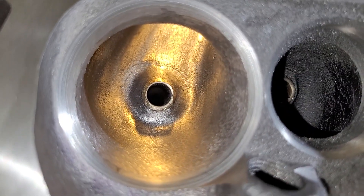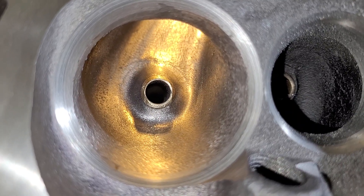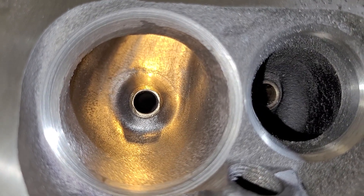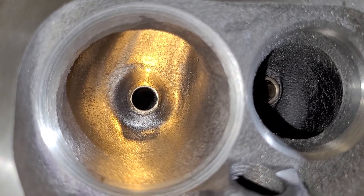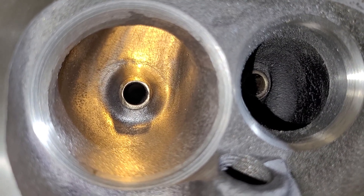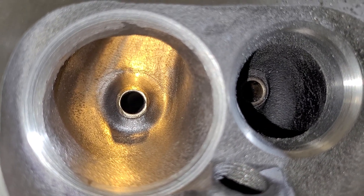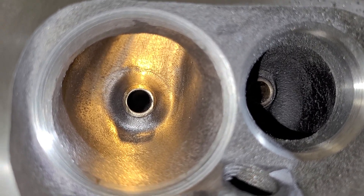At 94 mph in the eighth, and his car weight is 2,745 lbs — that calculates up to about 339 horsepower right now, which isn't bad on a stock short block, stock cam, high-ratio rockers, GT40Ps that haven't been touched, with a set of springs on them, an Edelbrock Performer intake, and a tiny carburetor.